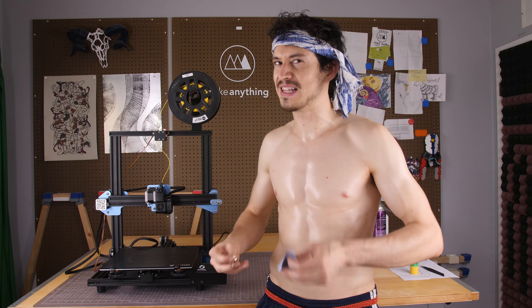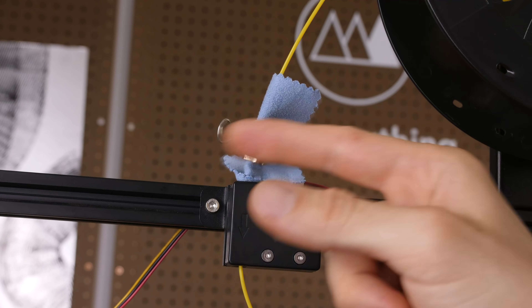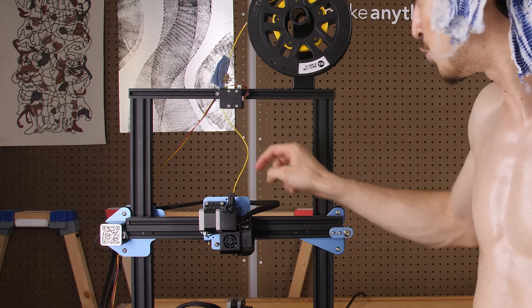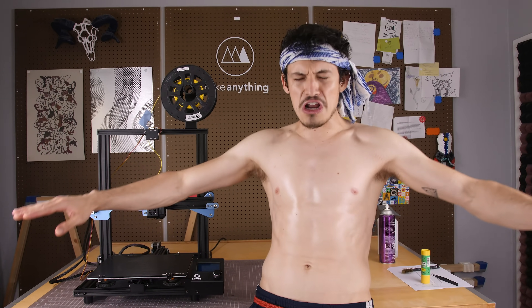While there are files you can print, this is the easiest way to do it. I have a small microfiber cloth and a binder clip — and that's really it. We can just wrap this cloth around the filament and clip it into place so that the filament can still pass through freely, but that cloth will pick up most of the dust. I clipped mine above the filament runout sensor, but you can clip it anywhere above the entrance to the hot end and you should be fine. That little clip alone will take care of a lot of the dust, and you'll be surprised at how dirty that cloth gets after just a few prints. It's a great technique for generally maintaining your 3D printer for longevity.